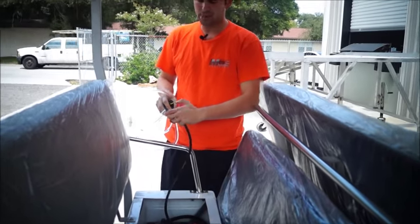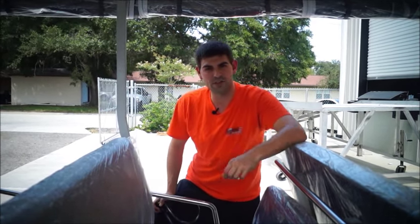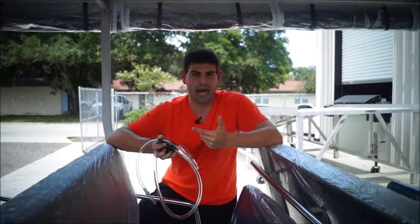And the cool thing is the biggest cause for batteries to go bad is actually overfilling them. You would think most people let them run dry, but they actually overfill it, and then as they're riding around, the distilled water comes out of the batteries, corrodes the cables, and then your battery goes bad. You know, a battery ranges from $100 all the way up to $300, so you really want to protect these things. So, more of the story: get a battery watering system.